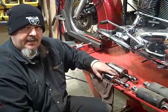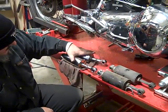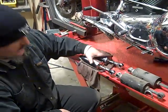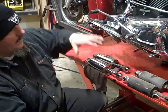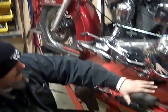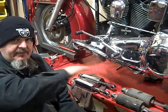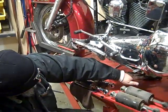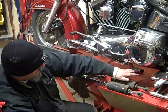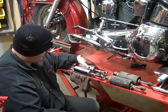We also want to make the kit as easy to install as possible, so we're just going to replace the stock shocks with these brand new shocks. The bike's 15, 16 years old — it's probably due for shocks anyway. They'll be fully adjustable. We're going to put a 4-under springer on it, and we want to be able to play with the height so that it sits perfectly level like a rigid 40s or 50s bike would have sat — about 4 inches of ground clearance, perfectly level. That's the reason we're going with different shocks.